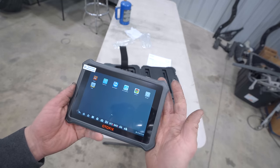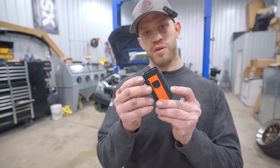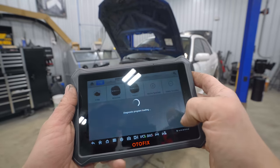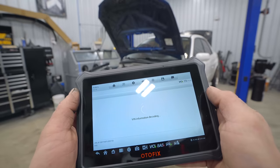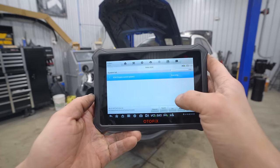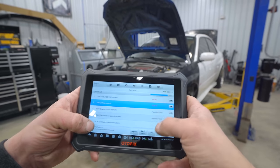I have a feeling this guy is going to be super handy to have around the shop — it's literally my Autel but a mini. Let's plug this thing in and see what is going on with our ABS system. This is the VCI — it plugs into the OBD2 port right there. Click on the ignition. We don't even need to be in the car to see what's going on. Click on Subaru, automatic selection, we're in North America, and it's going to automatically read the VIN number so we do not have to do it manually. Let's run a full auto scan — it's going to scan every computer, every module: ABS, airbag, engine, TCM, everything. We have three codes in the ABS system and four faults in the airbag system.